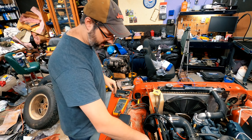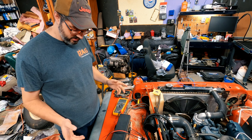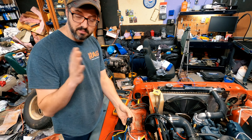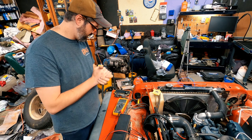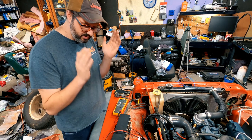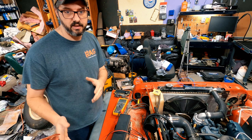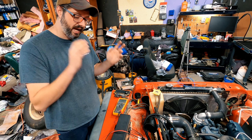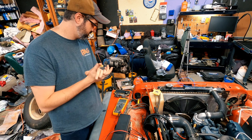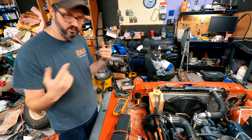Okay, I got my relay wired up. I tested it — it works. I saw the voltage bouncing between 14 and 16, and I think the relay is going to fix that bouncing problem because I've now got a direct link to the battery. The external voltage regulator needs that as a sensor wire to see how much voltage the battery has. So I'm going to open the shop door again and we're going to try this all again.